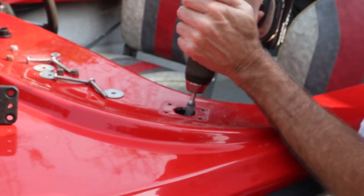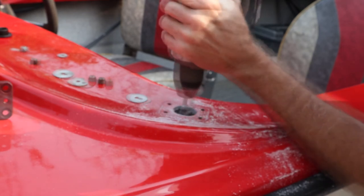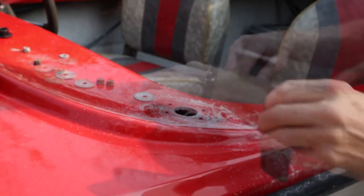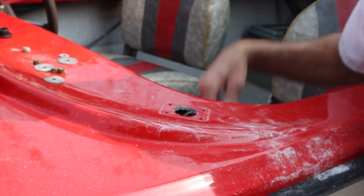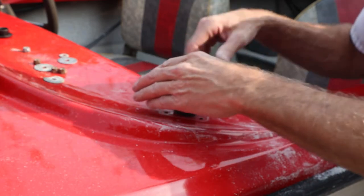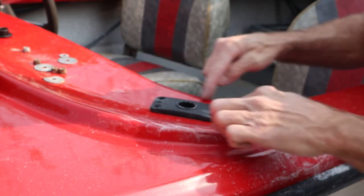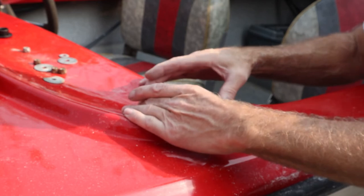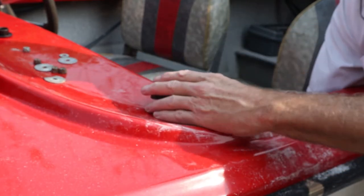Okay, we got it — took a few seconds. The underside of the bow of this boat has some fiberglass that's almost like the inside of cardboard — kind of waved. So when we mount this, the plate is going to bridge across that. We need a piece of aluminum that's a little bit bigger that'll fit up in here and not interfere with the cable that runs across for the steering — just a little bit bigger to spread the load, so when this outrigger is on here yanking sideways, it doesn't crack the fiberglass. Let's go find a piece of aluminum.